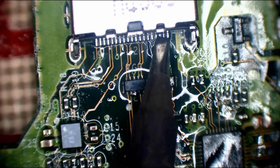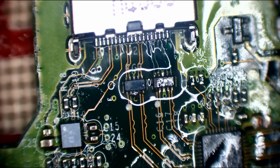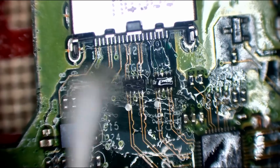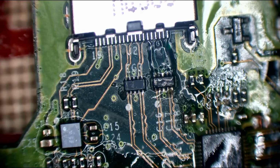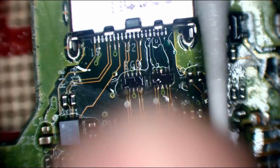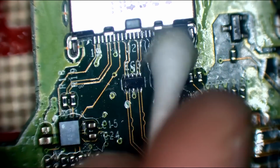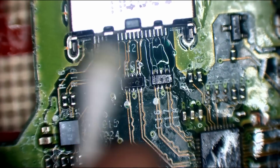And you see, because I've put conformal coating over it, the wires are going nowhere. And if someone needs to lift this port off in the future, they can. Because, like I said, the jumper wires are underneath these filters, and they're also underneath the conformal coating. So it's basically like the trace repair never happened. Even when someone lifts the port off again, unless they actually damage traces doing it.